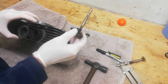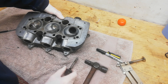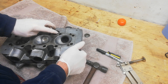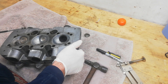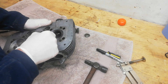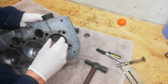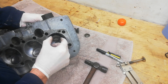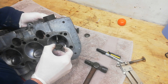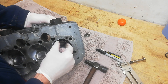We've got the valve and there's an awful lot of carbon build-up on the edge of this valve, so it's not looking great. To check the valve guides, we slide the valve almost home and then waggle it. The more waggle there is, the more worn the guide is. You don't want to check it when the valve is virtually out - you check it when it's virtually home.